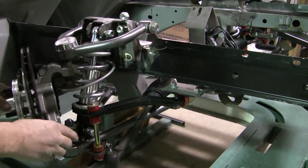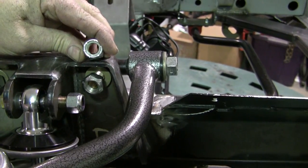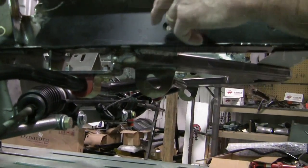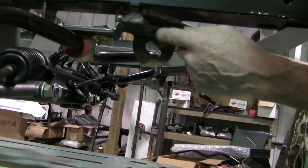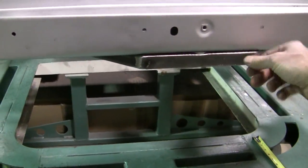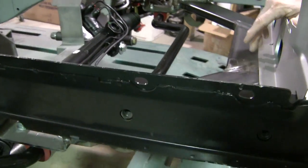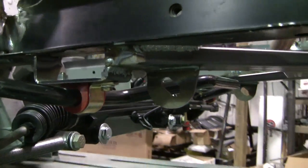With our new design of the upper A-arm bracket we also decided to use a swedge nut for locking over a poly nut, which has more than likely a great failure rate to come loose compared to a swedge nut. Now you can use poly nuts on the shocks and on the sway bar, but we just wouldn't use it up here. Now we also wanted to show you our jack pad and why you want to make sure you have the measurements right — not only for the sway bar but for the jack pad. You don't have to use this if you don't want to — you can still use your factory ones. This one's just easier to work with because it allows you to jack the car up without crushing the bottom of your rear support, and it has tie-down hooks so if you're transporting and hauling cars it's just very handy. We use it on basically everything we build.